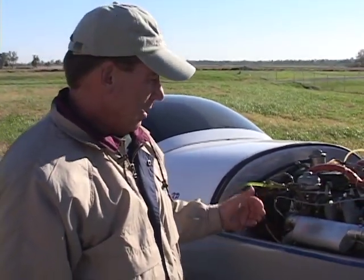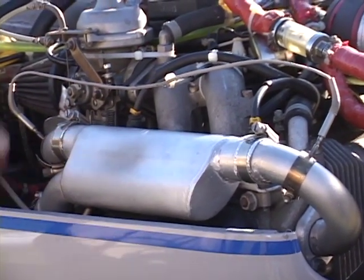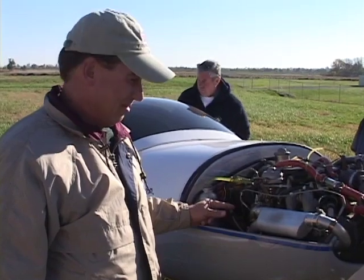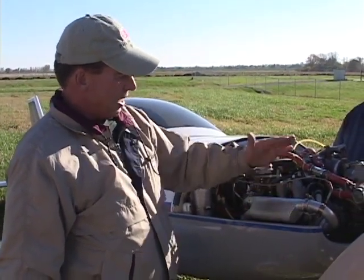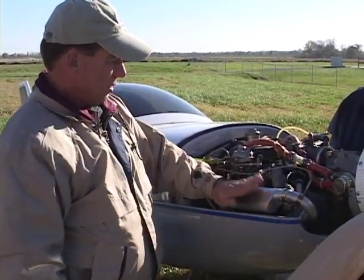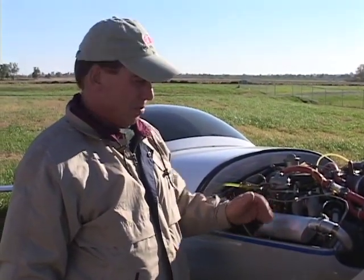It was time to do what I'd been thinking about. Knowing that my system was about to wear out, and that everybody else would benefit if it did work out, I had this vision of a small muffler on each side right here. The Pulsar cowling is so tight there's not room for many alternatives. The old system had a vertical can with an exhaust flow of about this long from the rear cylinder into the canister, and this long from the front cylinder — totally, totally unbalanced, with no way of tuning. So I wanted a small muffler for each side that would sit comfortably inside the cowling and balance out the flows from all the cylinders. That's what I've achieved — each cylinder's exhaust stream travels exactly the same distance. It's not a tuned exhaust, but at least it's a balanced flow exhaust.